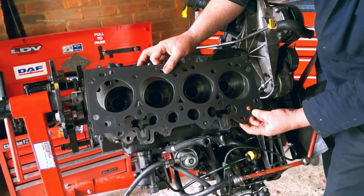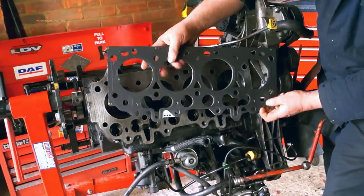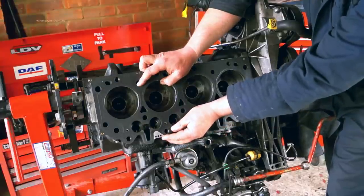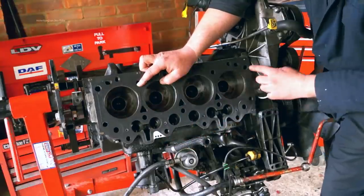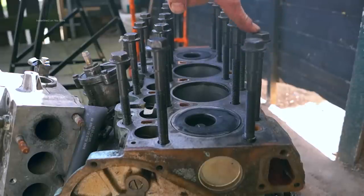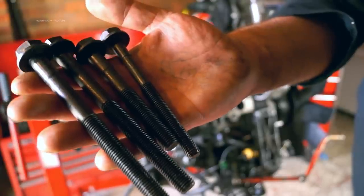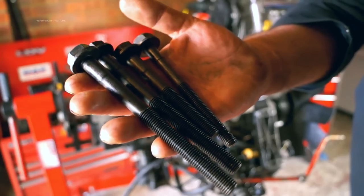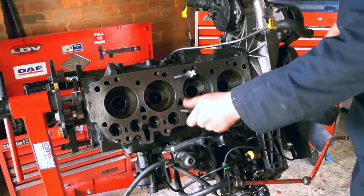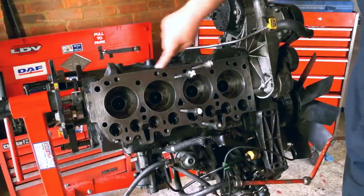I'll use the oil hole as a reference to orientate the gasket — it's going to go on that way. Where my fingers are there's an oil hole, and you have your three markers here. You'll also have some dowel pegs — they're actually in the cylinder head at the moment but should be in the block. I check the threads and make sure they're alright in the block and on the bolts. These have been used twice already by students. If you're pedantic like me, you'll screw them all the way in just to make sure there's no oil or dirt in there before fitting the head gasket and head.